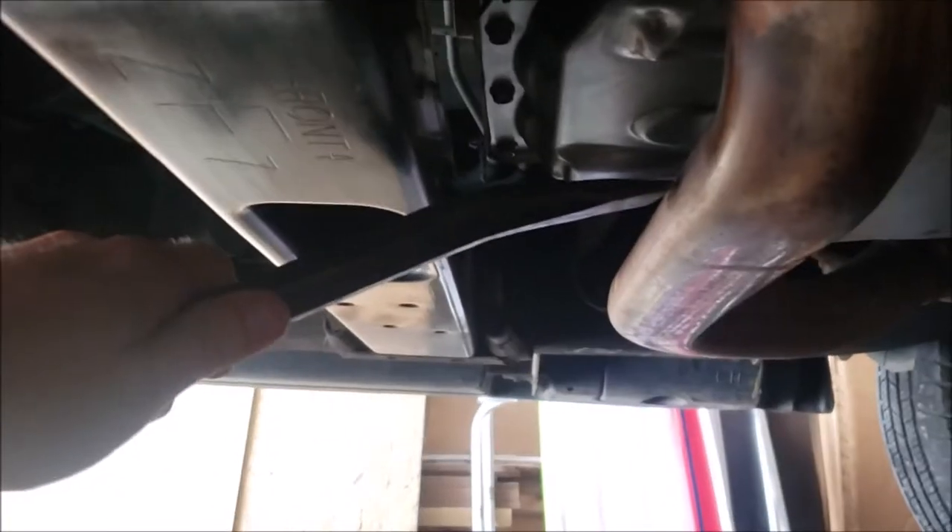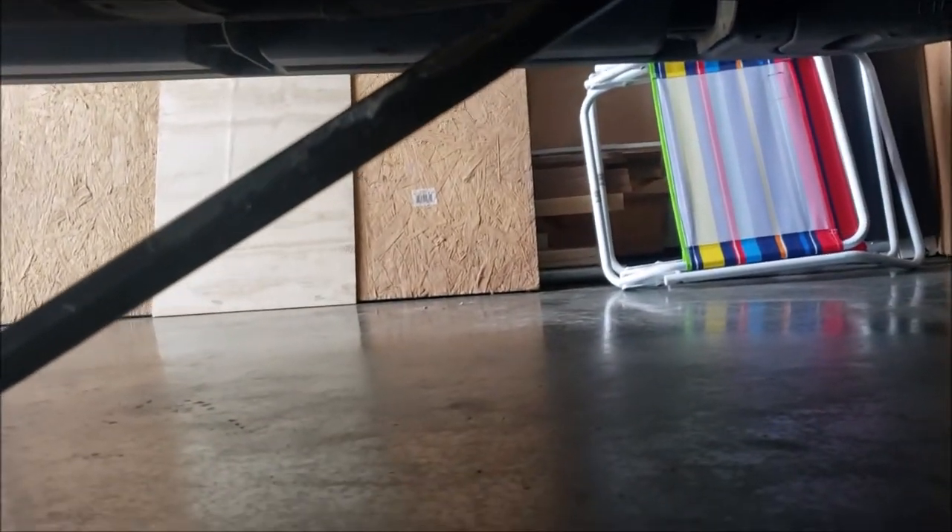Oh, there goes the knee on the jack — that's always a good feeling. That hurt. Don't bang your knee on the jack. So remember when you go to put this in there, you're going to put it in just barely, then push it until everything's level. Now see how it's propped up on the floor, it's square with the vehicle. Then take your jack and see roughly how close you can tuck in to the left.